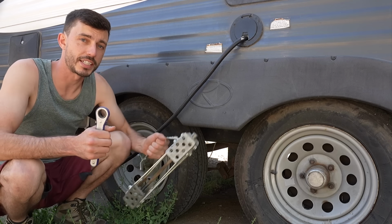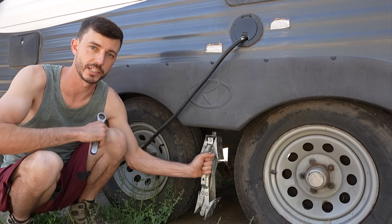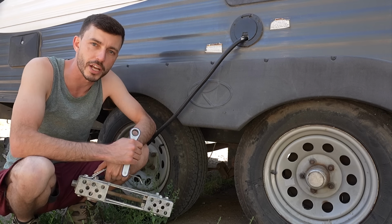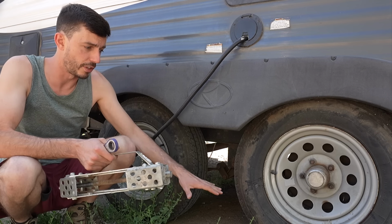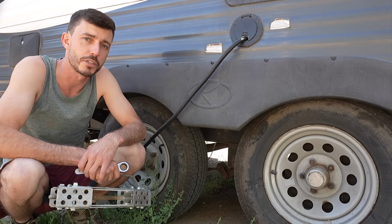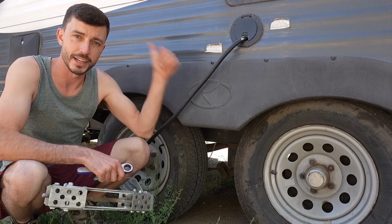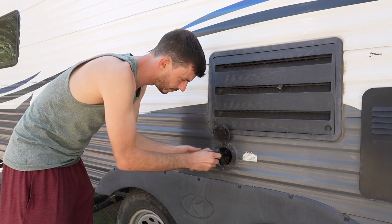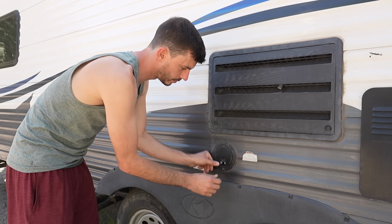And when I'm at the campsite, I typically have X-Chocks installed between my tires here just to stabilize my trailer. But I don't need them here, but that's another check I do. I make sure my X-Chocks are off. And my levelers, I've got Anderson levelers, but again, I didn't need them in this particular spot. I make sure that those are off and put in the back of my truck. And on the rare occasions that I have hookups out of sight, I will double check that my shore power cable is put away properly.